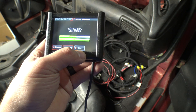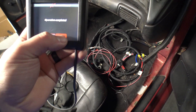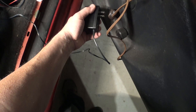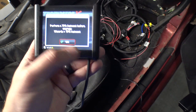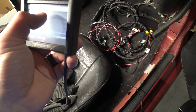Right now it's uploading my tune. You hear it working the idle air motor and everything. Wow. Well, let's power cycle it. I can't wait till this thing is ready to run. Check out my AC adapter here to power my Holley unit. All the LEDs flash on the box, the screen boots super quick. Got to do TPS - so I think for that you go right into the wizard TPS auto set.